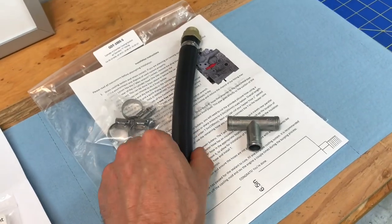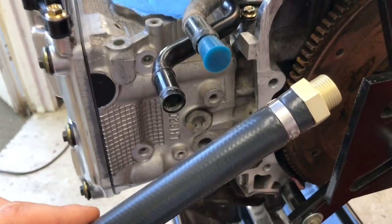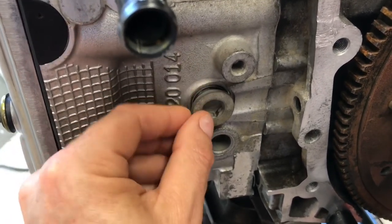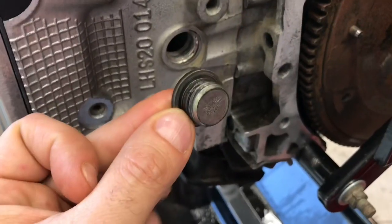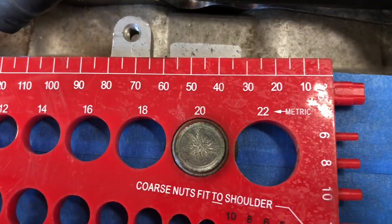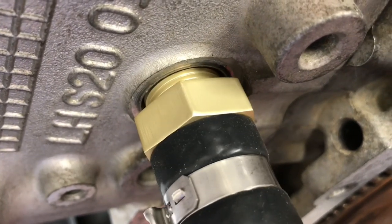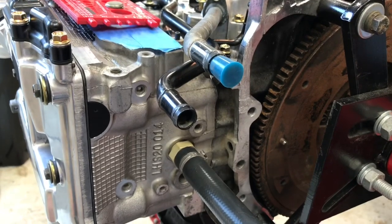Let's grab the Get-A-DOM Tune kit and walk through the installation on this EJ motor. We're here on the back of the engine — the left side, left cylinder head, which is cylinders number two and number four. We're going to remove that little plug right there, which goes into the cylinder head and taps into that coolant passage right behind the combustion chamber. I have my little sizing gauge — the plug is an M20. You're probably going to want to put a little RTV on this — you can use Ultra Gray or the Subaru OEM RTV. So you're going to tap it in right there to the back of cylinder number four.